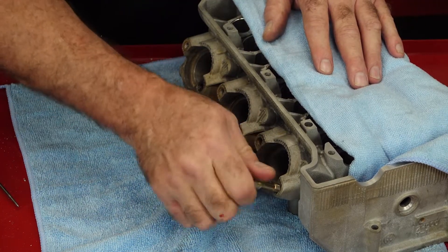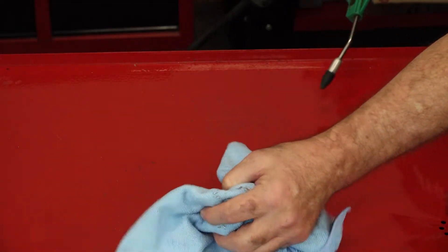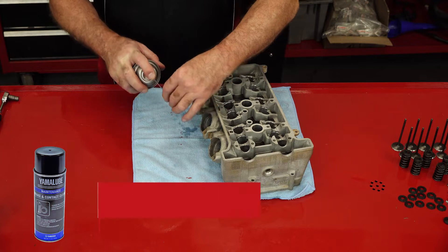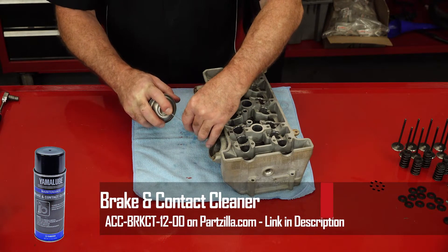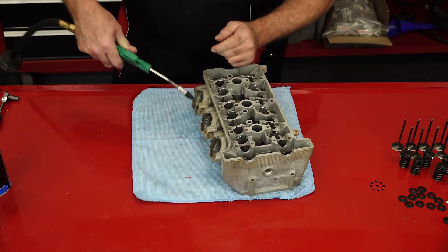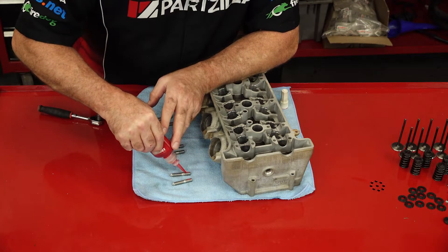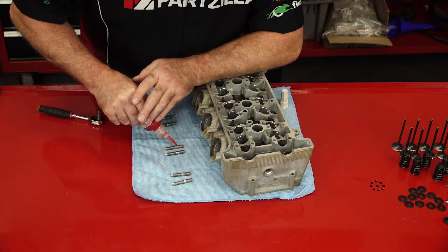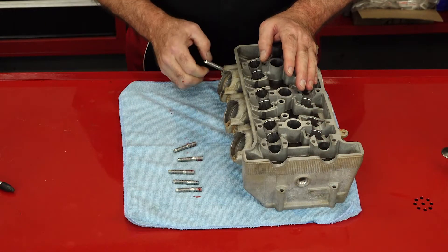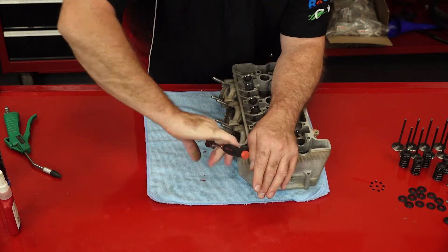Now I'm feeling warm and fuzzy about all of this. Let's get rid of all these towels with shavings on them. For this I'm just using the standard brake and contact cleaner from Yamalube. Now let's get these new studs put in. Even with high-temp threadlocker it's probably going to burn up considering where it is, but the main reason I use it is so that if you ever had to remove these, the threadlocker seals it up and keeps it from corroding — so should you ever need to remove these, they would come back out.